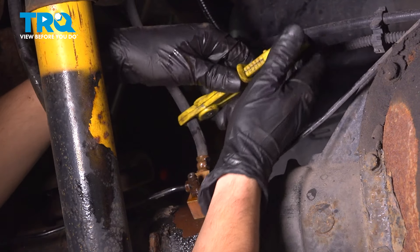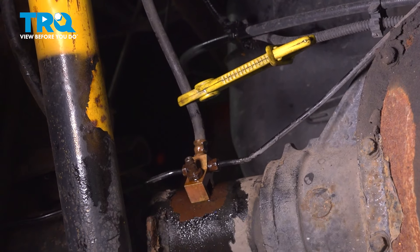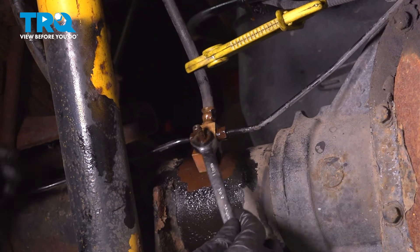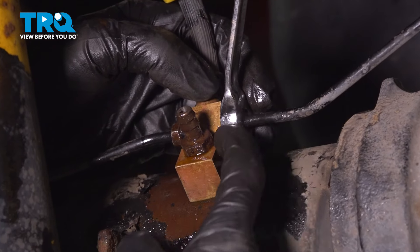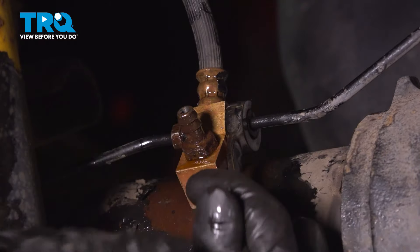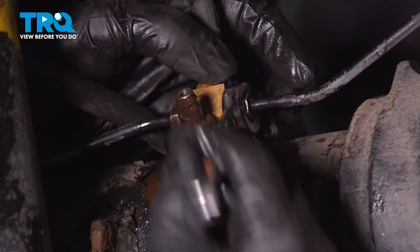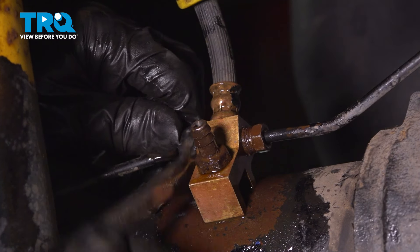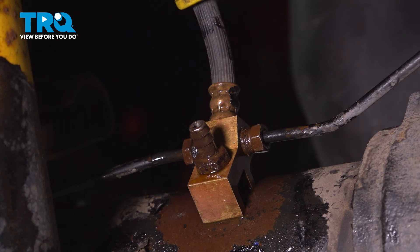I'm going to pinch off the old brake hose so I limit the brake fluid that comes through as I open up these lines. Next, let's remove both of these lines. You'll need an 11 millimeter flare nut wrench for this, and hopefully the line isn't so rusty that it gets stuck onto the fitting. A lot of times that happens. I already sprayed mine with some rust penetrant, and it looks like the line comes off the fitting very easily. I'm going to do the same thing over here, then switch to a regular wrench, just because it's going to be easier to use in a tight spot, as opposed to a flare nut wrench. Both of those are broken free.